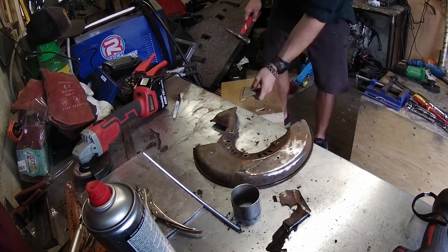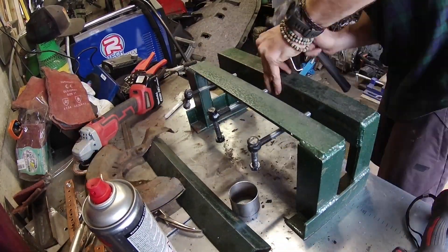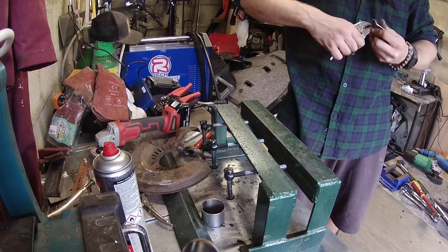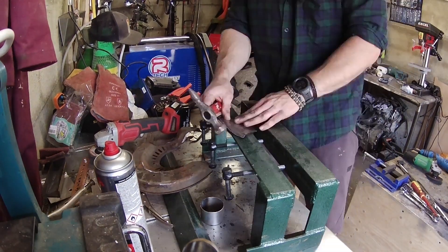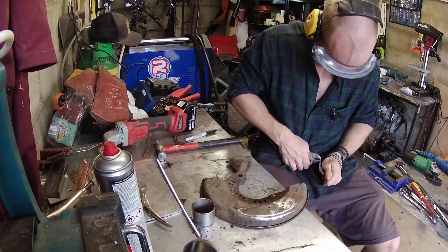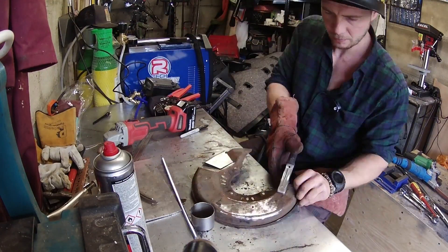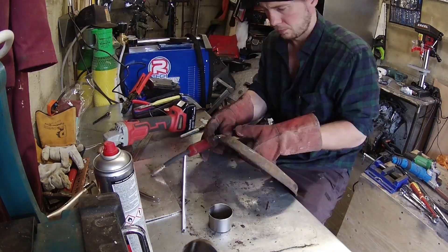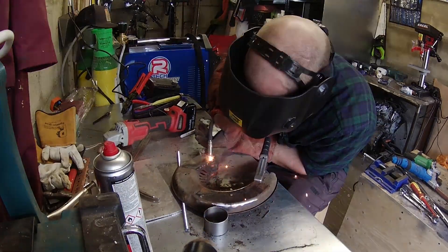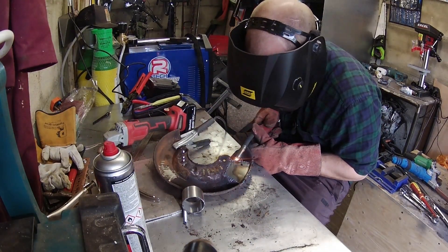I have got quite a lot of limited metal forming tools. I haven't even got a vise at the moment, and I don't really have a proper bench to tie it down to. I've only recently set up this garage as a workshop, which has been something I've wanted for years and years, and it's slowly getting there. This was actually a really complex shape — you've got a compound curve with a fold in it. I know it seems ridiculous to be repairing this, but I think it's really good to practice these things and generally practice metal forming — getting to work out how the metal actually bends, folds, what it does when you hit it, when it stretches, when it shrinks. Trying to weld this really thin sheet — in places it was so thin the MIG welder was all the way down and it was still just blowing holes. This is actually still some of the most successful sheet work I've done in terms of welding and rust repair, and I just think it's really useful to practice these things. That's why I've done it.